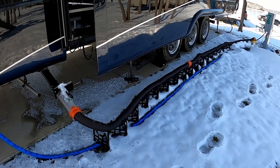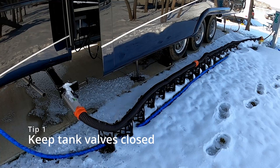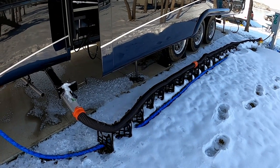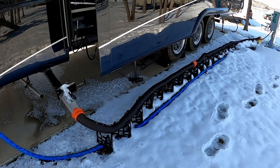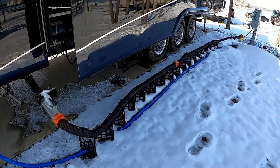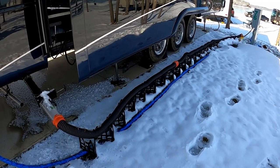A tip for your black and gray tanks is to keep your main valve closed. That way you don't have fluid coming out into your hose, which may freeze and expand and bust your hose. You just need to empty your tanks as needed. When you do, take the extra time to lift up your hose and make sure you get all the fluid out so it doesn't freeze and expand while it's just sitting there.